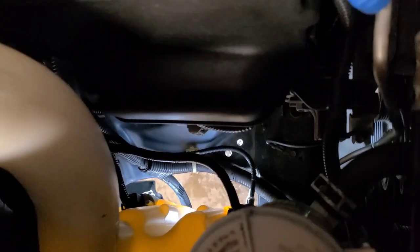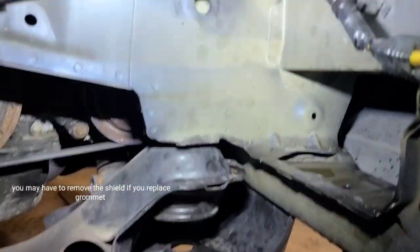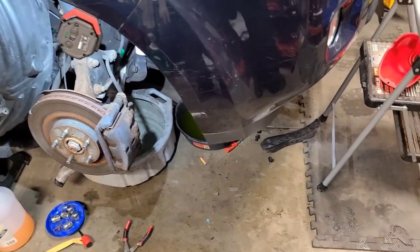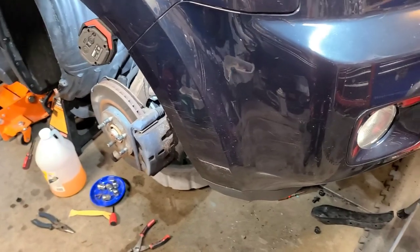This motor over here is for the front and the motor we just replaced is for the rear — so dual motors, one in the front and one in the rear. Hopefully this helps you out on the repair. You may not have to remove the inner liner shield — this was my first time doing one of these. You can actually just pull it straight up, but you might still have to move the inner wheel well lining and use a flat-head screwdriver to work it up and out. This is how you change the windshield washer motor on a 2009 Honda Pilot EXL. Hit the thumbs up, subscribe if you will, and always remember rust is the enemy on these things.